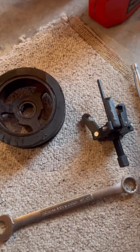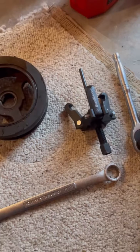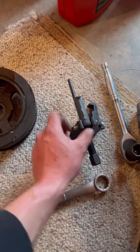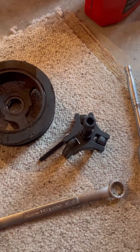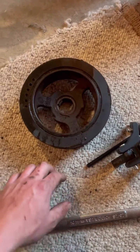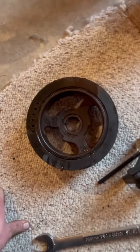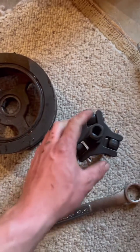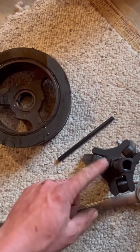This is the O'Reilly Chrysler harmonic balancer puller — with the second longest push rod it works perfectly for a Ford 5.4, later model, that has these holes cast shut. I had a lot of problem finding a proper harmonic balancer puller because I couldn't find information on it, so I wanted to share this with you.